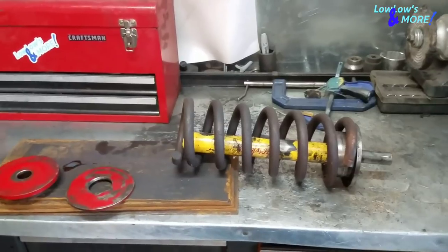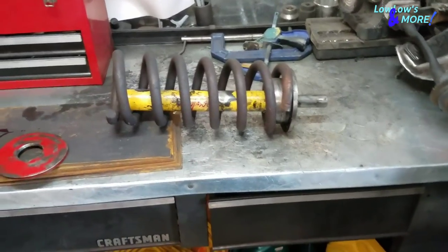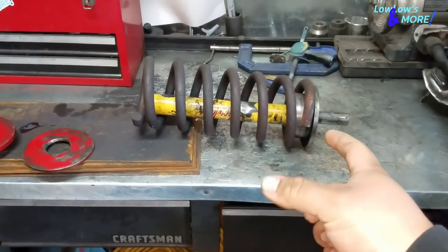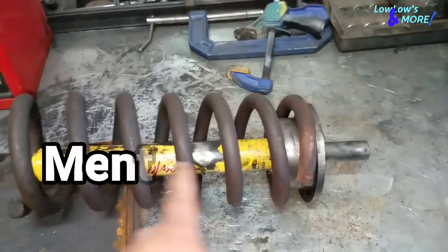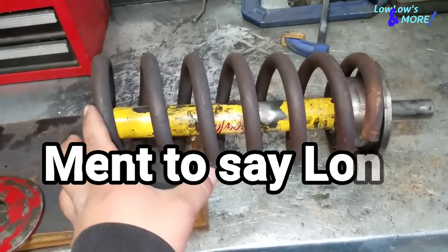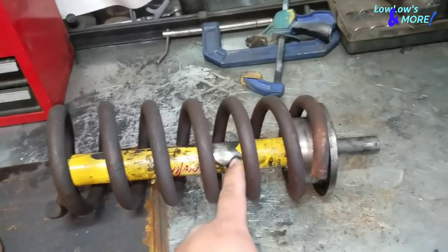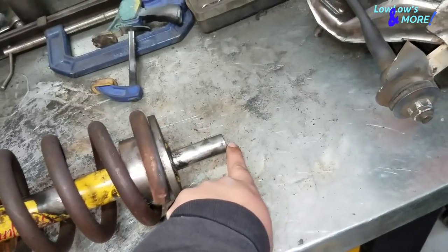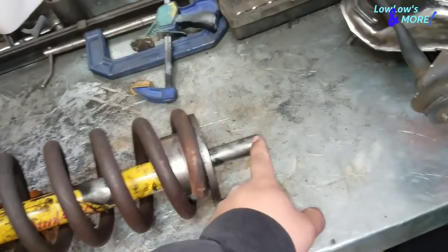Someone asked how are the cylinders mounted in the car, so I'll just show you real quick. A lot of you already know but a lot of people don't. This is how you'll have your cylinders set up for the rear - you'll have your powerball mounted here, the cup and ball mounted here. Make sure you put the cup over the cylinder and then mount the ball, that way when you slip these in the rear you'll just screw on the cup onto the main powerball base.